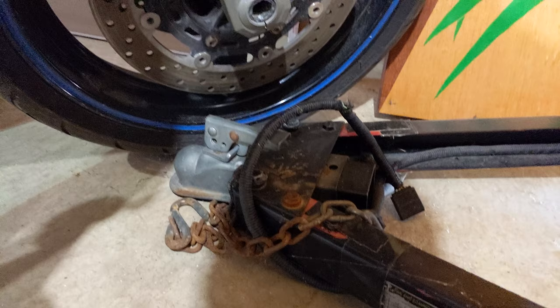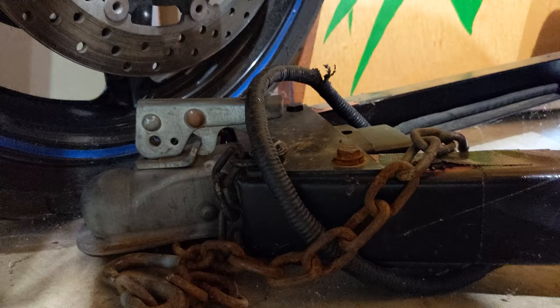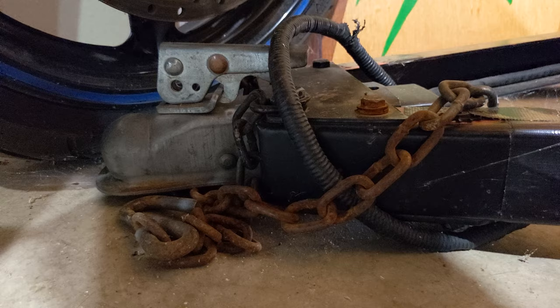Okay, as in my other micro camper here, I do like a little cheating thing with these Harbor Freight trailers. I didn't put this trailer together, but I did move the receiver down into the middle of the frame, like this, instead of being on top of the frame, like the directions show. What that does is allow a car, which is lower than a truck, to pull this trailer more level, so that nothing's squatting and nothing is riding weird with the front end up or the back end up. This really helped with my Saab car.